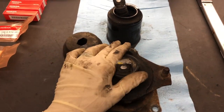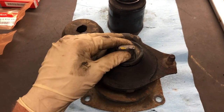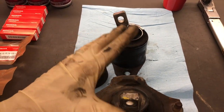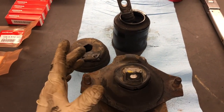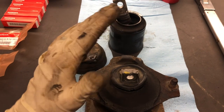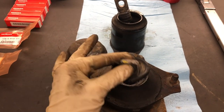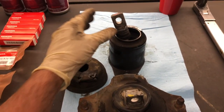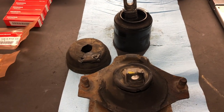Both engine mounts removed from the car — this is the front mount, this is the passenger side mount. Both of these mounts weren't doing anything really. There's a bolt that goes through this hole, and a bolt that goes through this hole, that connects the mounts to the engine brackets. When I was pressing the brake and gas at the same time and the engine was going up and down, it's because this just wasn't connected — there's nothing connecting this. It was just going for a ride, with nothing really to stop it outside of the remaining three mounts in the car that are still good.